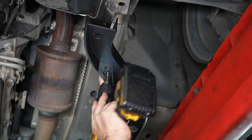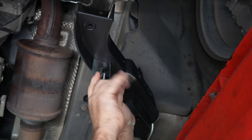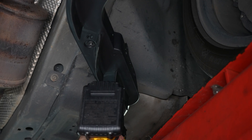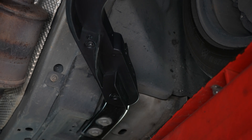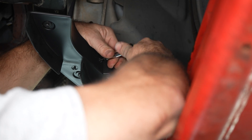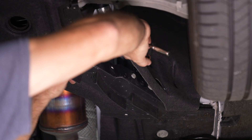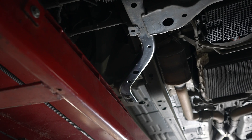The process is the same for the other side — mark the spot, drill, and screw it into place. Continue in both the front and the rear. Lastly, the side hole to secure it all into place. On the S650s, there's a bracket that hovers off of the subframe and secures one more bolt, but the S550s omit that, so this hole is not used.